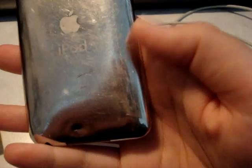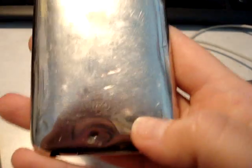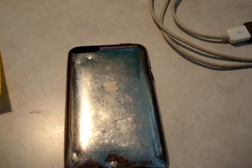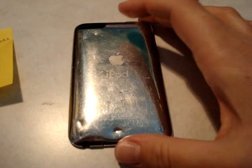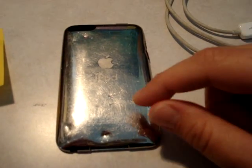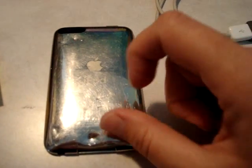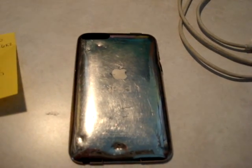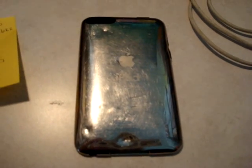How I know that is by looking on the back of the iPod. What this tells you right here is the model number, which I had to use a magnifying glass to be able to see, but it's still very hard. Because of the way that this iPod is made, this scratches off pretty easily. So what I ended up doing was drawing on it with a permanent marker, and then I used my finger to wipe it into the little writing right there. Then I was able to use a magnifying glass after I wiped the permanent marker off and actually be able to see the serial number to find out what software I needed to download.